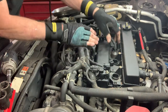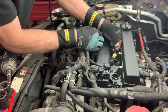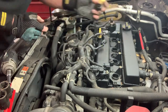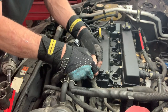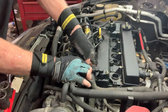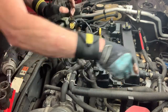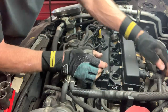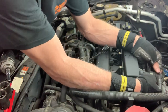All right, so we've got our injectors unplugged. Our knock sensor right there in the center — unplug that — gets all our wires out of the way. Cam sensor plug right here. Got wiring tabs here and here holding these wires on — lift them up, pull them to the side. There's a hose right back here going to the valve cover, need to remove that.